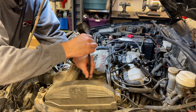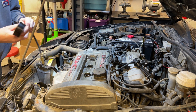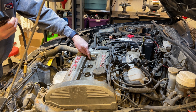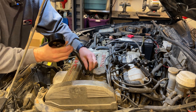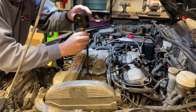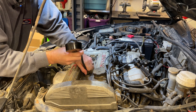That one actually looked pretty good — we got 155 PSI in this cylinder, which is within spec. This is a turbocharged car, and 114 PSI is the minimum spec, so 155 is really healthy. When I did a cold test on this one earlier, it was over 150 as well. You don't want too much of a differential between cylinders — even if they're all above 114, you've still got an issue if there's too much variation. Ideally, you want them within 5 or 10 PSI of each other.